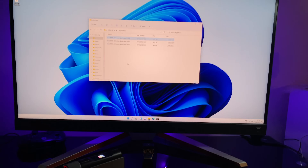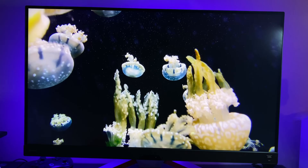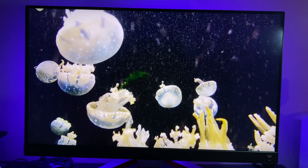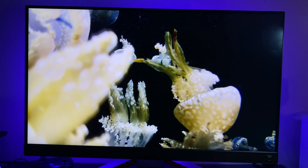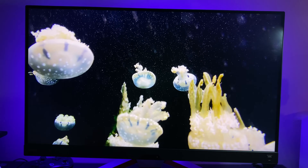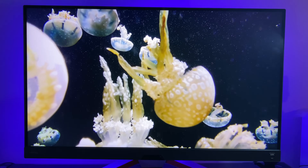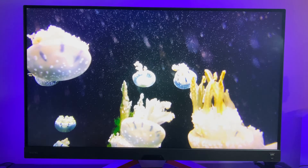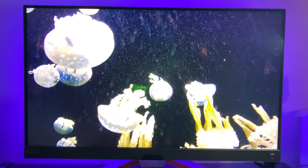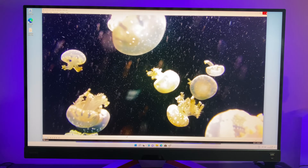I've attached a 64GB SanDisk and I'm playing 4K samples directly from that drive. The first video at 160 megabits per second plays pretty smooth with no issues. The second video at 180 megabits per second also plays absolutely fine. Next up, the 400 megabits per second file — there's a little bit of jittering, it's not as smooth, but it is playing. So high-bitrate 400Mbps is struggling a little and you can see it stuttering. Let's also try regular 4K 60 with HDR.